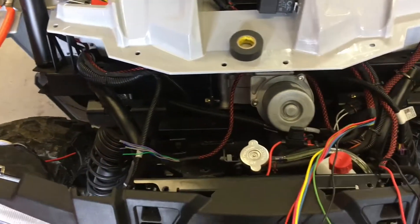This here is for the MTX stereo - the overhead stereo. My diagnostic plug can wrap around the power steering and hook in there. I moved it - it originally was on the other side. I flipped it around. This is the other headlight plug - I'm going to bring it up and I took the other plug, RTV siliconed a cap on the back side to seal off this connector since I'm not using the factory headlight harness anymore.